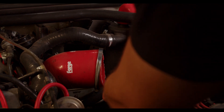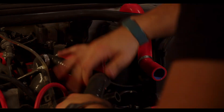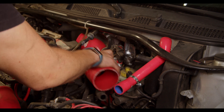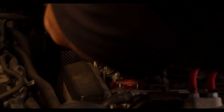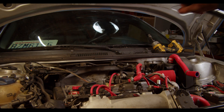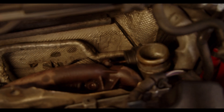With that out of the way, we can move our sights over to the intake side again. We're going to have to remove the turbo inlet pipe since we have no real use for it anymore — it's way too small for the turbo we have. But before we can really remove it, we need to move all the lines connected to the oil catch can, and that part is likely going to stay. With the catch can lines sorted, we can move on to the back of the engine. Right now our goal is effectively just to give ourselves as much clearance as we possibly can. To even entertain the idea of fitting my arms back there, I need to remove the strut brace as well as the little bracket on the back. And if you remove the little silicone outlet from the turbo, you can actually see the manifold — this is kind of where we're going to be working for a good percentage of this job.